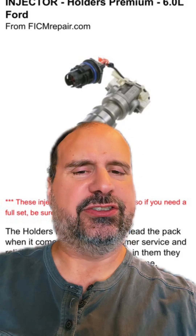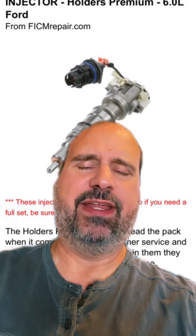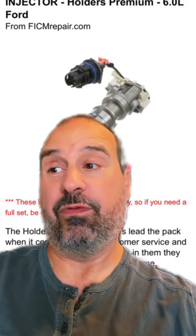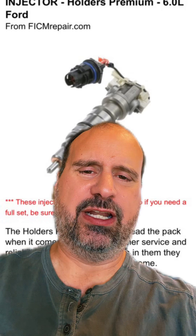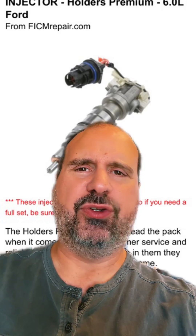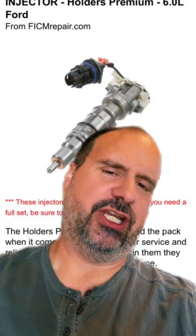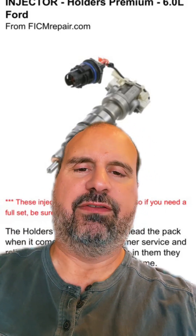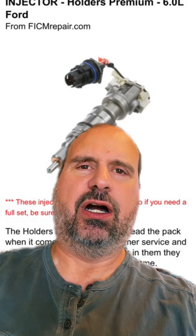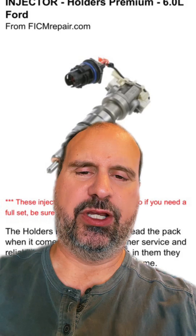The only drawback here is you're also not sending voltage to the IPR valve, which means half the output of the high-pressure oil pump is going right back into the oil pan. But at least you're purging air out of the system. Keep doing 15 seconds on, 45 seconds off, until you hear the pitch change. When you hear the pitch change, that means you now have high-pressure oil — you're pumping under back pressure.